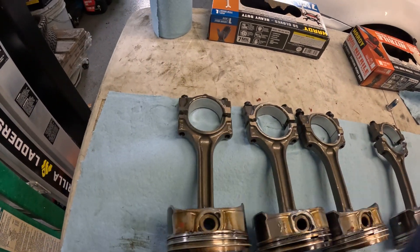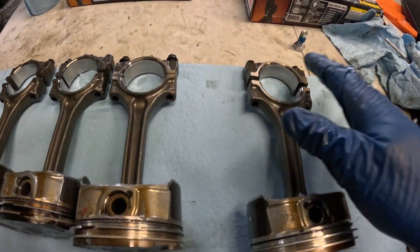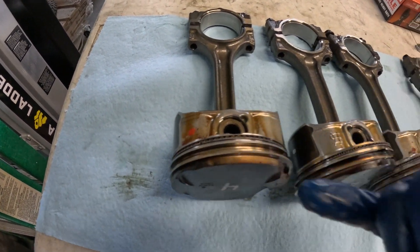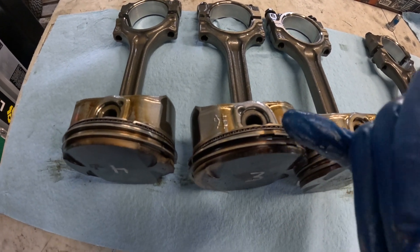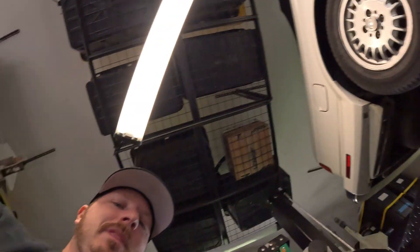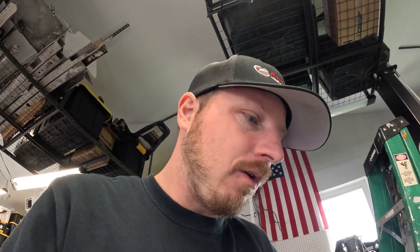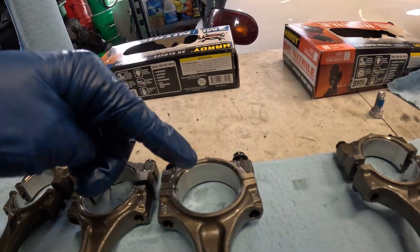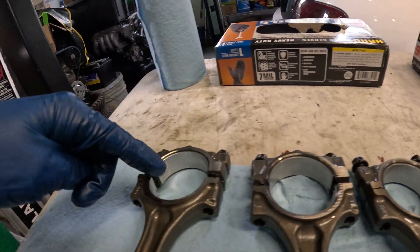So if it's detonation, why don't my rod bearings look worse — or is that expected? It looks like piston number three was ready to let go too, definitely with that second ringland area. So we have pistons two, three, and four ready to go. That's interesting. I would think if it was an oil issue, we'd see more on the bearings themselves. But again, I'm not an expert on this. I don't know if it was detonation — I think you'd see more here. I don't know what detonation looks like in a rod bearing, but I believe it crushes it or something. Nonetheless, experts, let me know your thoughts on what caused this failure.